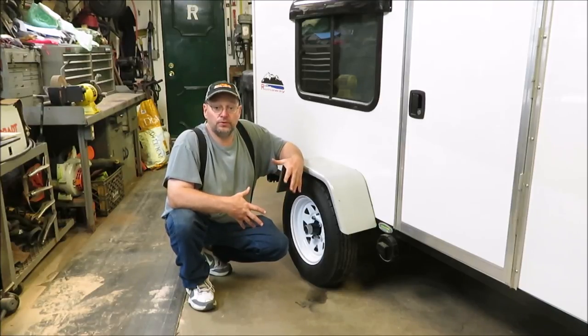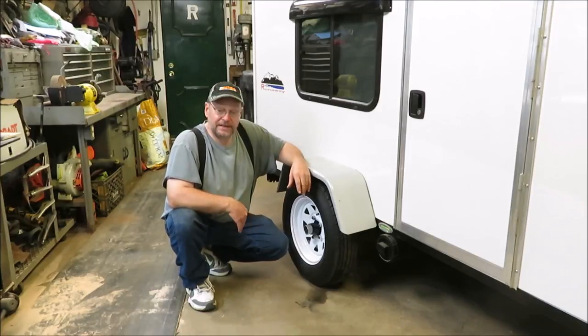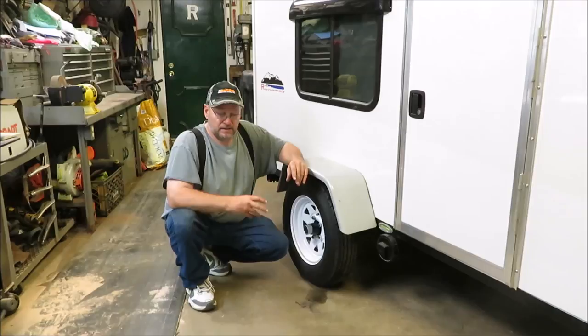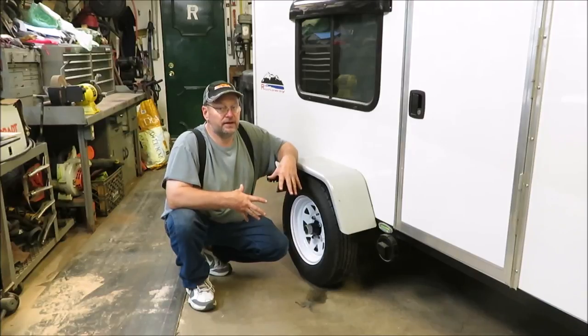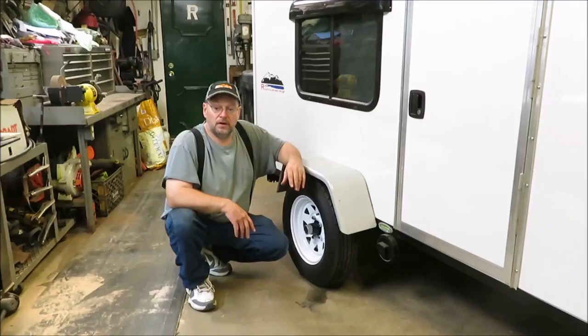The Dexter axle is great because you can buy any part you need — they're really good people, they'll work with you on anything. We were blessed to get a very good set of axles under the runaway camper. Also get underneath there occasionally and check for loose bolts, broken or cracked springs. The grease seals from the Dexter axle website are only about six or seven dollars each. If bearings are cracked, discolored, or damaged, get them replaced. Dexter makes a great axle — definitely the right choice for the runaway. Hope you guys enjoyed the video. Don't forget to subscribe and leave a thumbs up or a comment. Till next time!